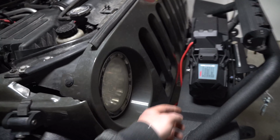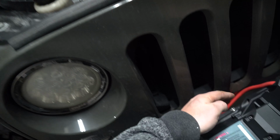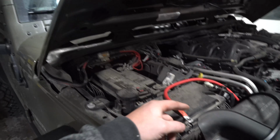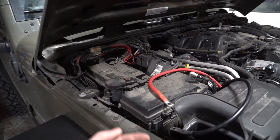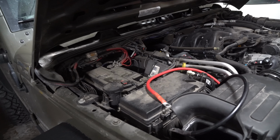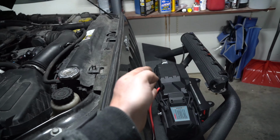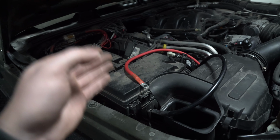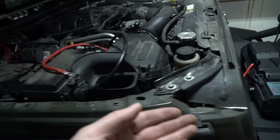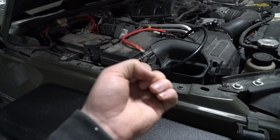Now this black wire, I'm gonna attach it to the other side of the opening like so. I'm gonna attach to here. After I do that, I'm gonna start zap strapping these up. If you're a car audio guy like me, you'll notice I have fuses on everything. Now I've read online that with winches, you don't bother fusing them, because these things pull such high amperage that you'll end up blowing your fuse. They say simply leave it unfused. The control box takes care of anything. And that's gonna make me really say to you, make sure you loom this wire. Because if you don't fuse this and it grounds out and shorts against metal between here and there, that would suck. So I'm gonna be very careful with mine and definitely going to, like I said, loom.